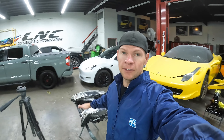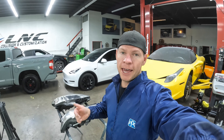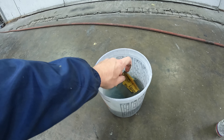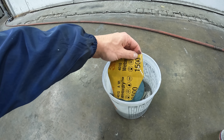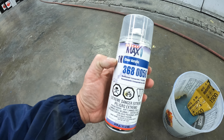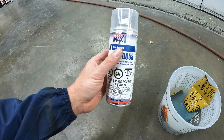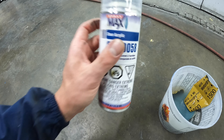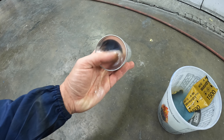It doesn't take much to get your headlights looking brand new and this is a permanent solution that will not fade back. All you're going to need is a bucket with a little bit of water and some sandpaper. We're going to use 1000 grit and then 1500 before we clear coat, and you can use a store-bought clear coat in a spray can. They have a 2K which is activated at the bottom and only lasts for 24 hours, but it's going to give you a better and cleaner look.